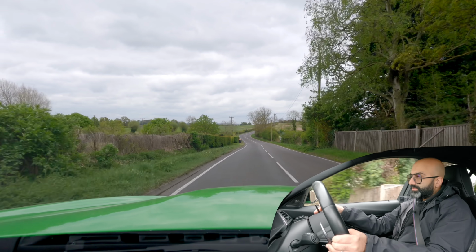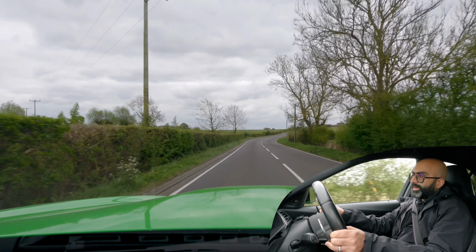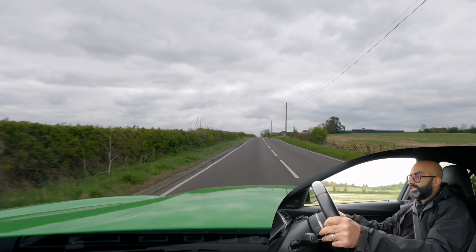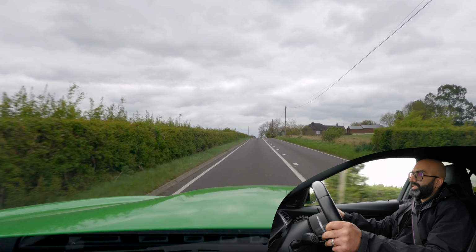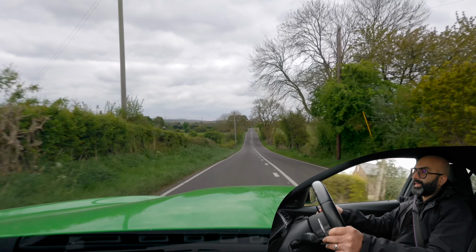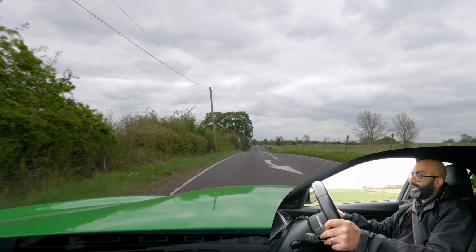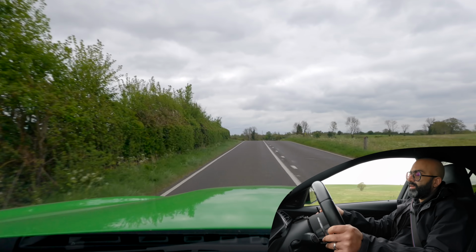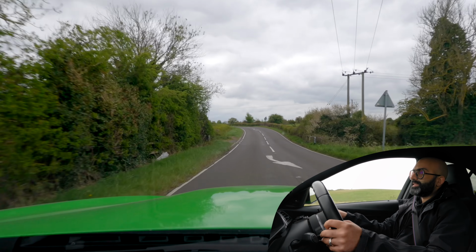It feels more linear, I would say, but as I said, the turbo lags a little bit harder. This car does have a Deca stage 3 clutch, which is slightly more grabby than the stock one, but with the extra torque we run when we go to Vmax, running race fuel, we do need that extra clamping force from the clutch itself. In terms of suspension, this car is running our Bilstein B6 EDC dampers with the MSS.